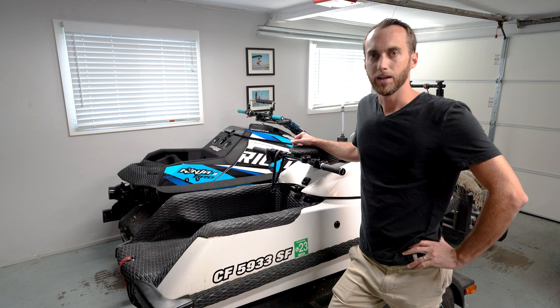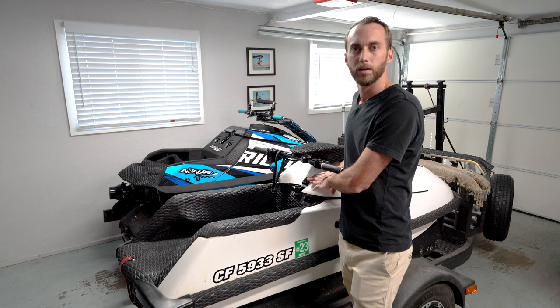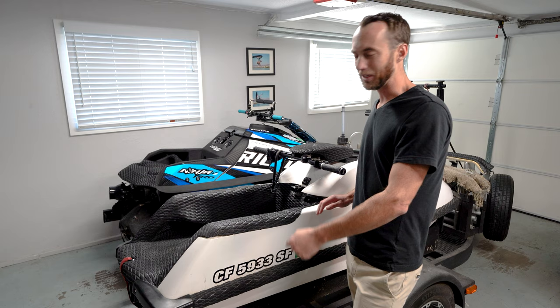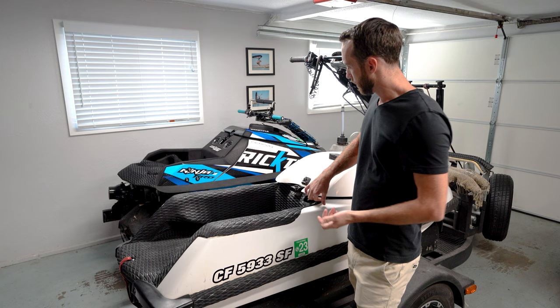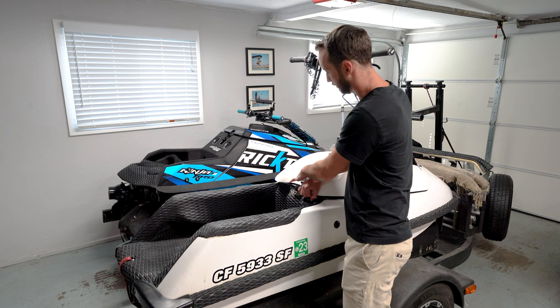So that's number one. And the second thing that I really recommend is to pop the hood, because there's always going to be water in your engine compartment. It's unavoidable. This isn't a sit down jet ski. You're going to be getting wet, tipping over, going through waves. So at the bare minimum, I'll get home, put it in my garage, and pop the hood latch. At very minimum, I'll lift it up and put the latch under the hood so you have air getting in there.